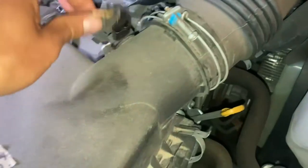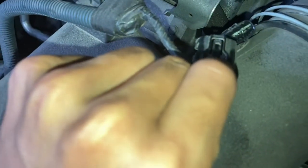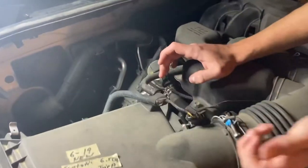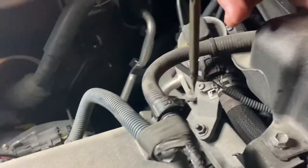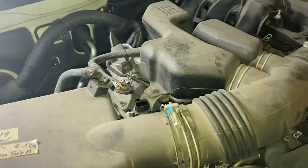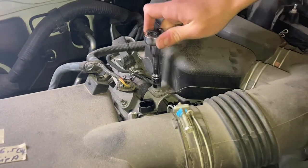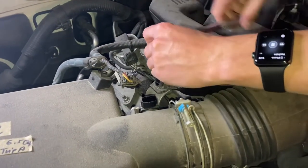Cut the video after you get these removed. Pop off your MAF sensor — there's a little tab, you just have to squeeze right where my finger is and pull. To remove this little clip, you stick your flat head screwdriver in between here, push in, and then lift up where it says 13. Then take your 10mm socket and remove this bolt here.